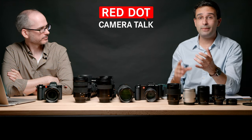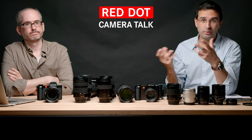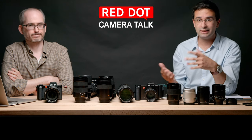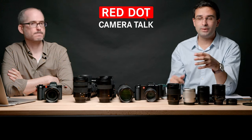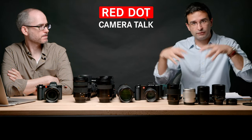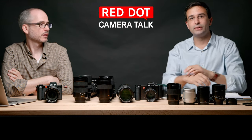Number two, you do not want to change batteries or memory cards or make any kind of hardware changes to the camera while it's wet or in the rain, because then you've compromised the weather sealing. Number three, you want to avoid standing water on the camera. You don't want to let any water pool in any of the spots on the camera because the pressure from the water pooling can get in. So that's the other key: not letting standing water on the camera.